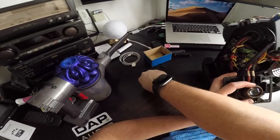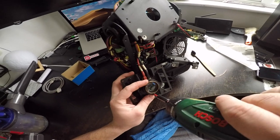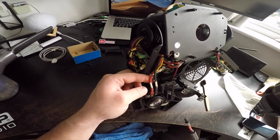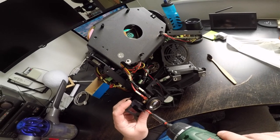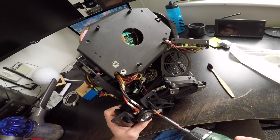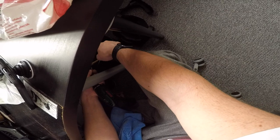Now we put the lens back. When you disassemble such a thing there's a sensor wire here — this is really tight in there. Make sure when you put it back, the sensor wire is still in there. Because otherwise, if the LED overheats it's gonna die. With the sensor wire in there, it doesn't let the LED overheat. Therefore, it doesn't die.